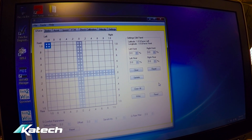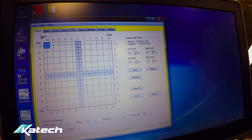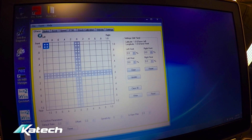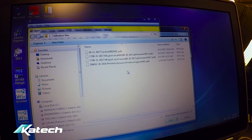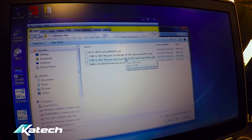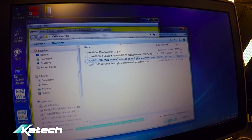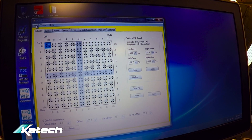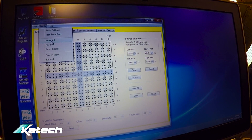The board is reset, which means we have a connection to the DSC Sport module. We've already downloaded the latest Tractive shock file with the firmware update that was done in August. We're going to go select that file — it's the Tractive file with the firmware update. Opening that populates the file through the software. Now we're going to write all.